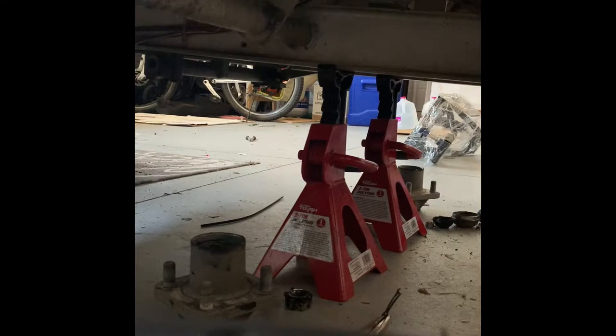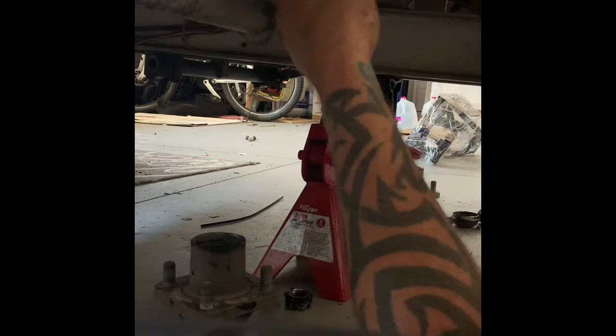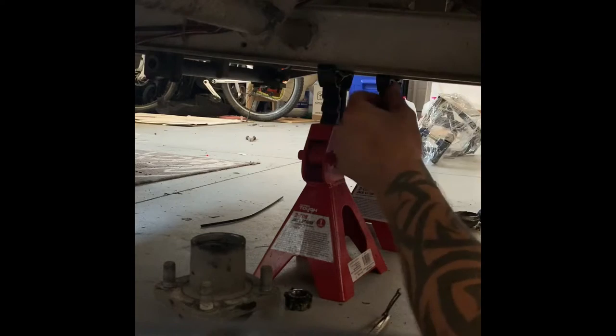Obviously the steering rack just joins right across the top, both the wheels. It's actually a connecting rod. Your steering rack's actually this one here. I don't know if you can see that, can you? Yeah. That's your connecting rod that goes right across the top to the other side. It's the side I disconnected before, right there. And this is your actual steering rack that goes up into your steering up there, look. So it only steers from one side, but it's connected right across.